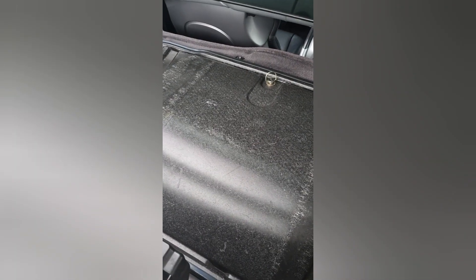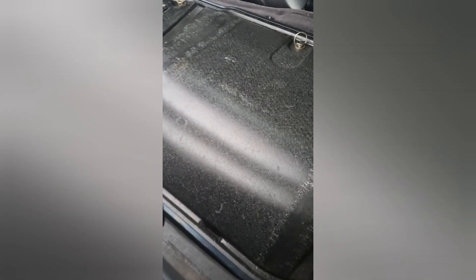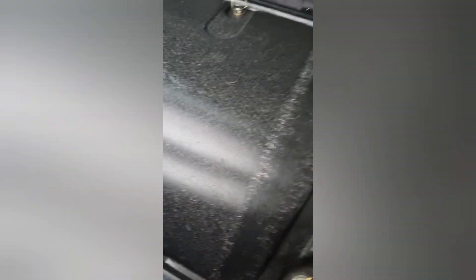The engine cover has twist fasteners — you've got five of them: three across the back edge behind the seats and then two closer to the boot lid. It's literally half a turn to a whole turn. Because of the way they're fitted you might have to give them a bit of a wiggle, but just turn them and the engine cover will come loose. There's one over here too — just give it a little bit of another turn.